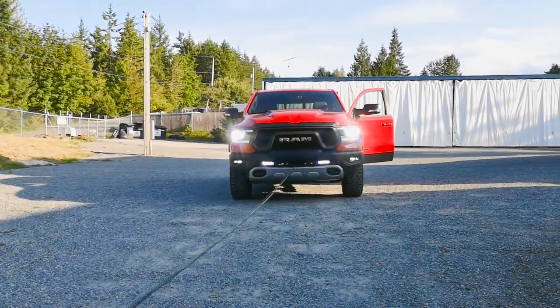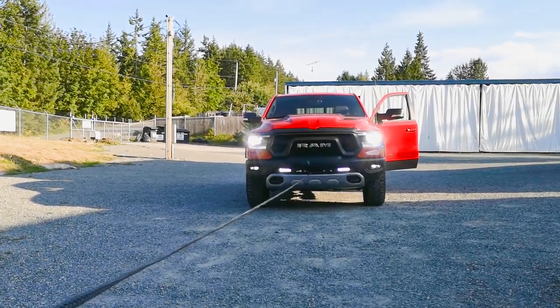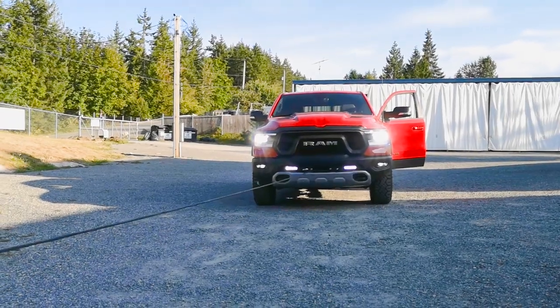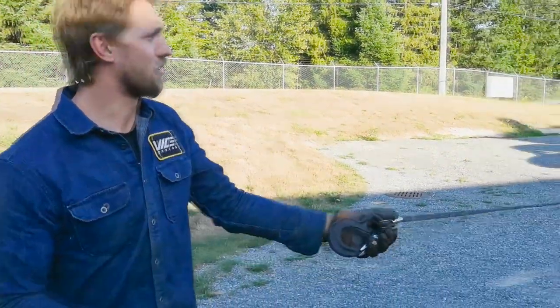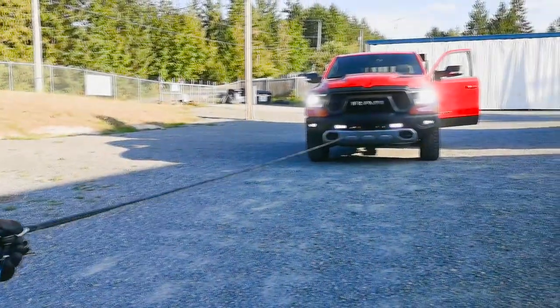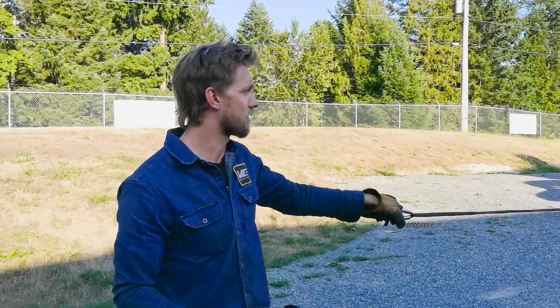Now this kit's designed for straight line winching only, so this is a straight pull — comes directly forward of the truck. You can go at angles up to 15 degrees, but you don't want to exceed angles of 5 degrees up and down. It will put a poor loading on the winch mount and cause damage.